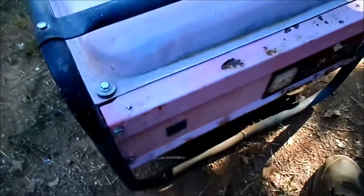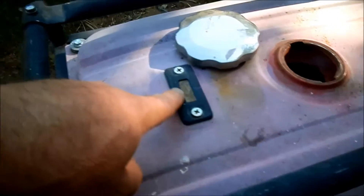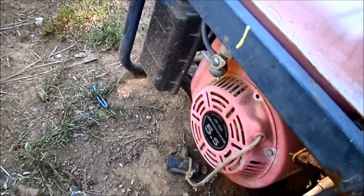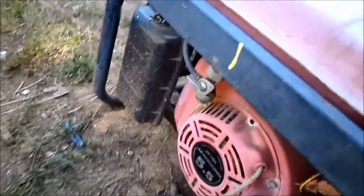That's pretty nasty, and I don't think it's fuel - I think it's water. I don't smell anything; it looks like water. I think since it sat outside for so long, judging by the bleached paint, that when it rained, water came in through the cracked fuel gauge and filled the tank up. Hopefully the fuel was off. I think when I picked them up the fuel was turned on on a couple of them and I shut it off, but I don't remember if this was one of them.